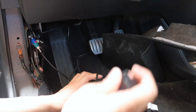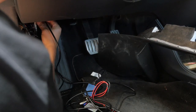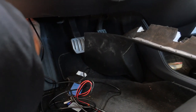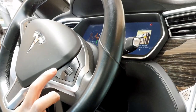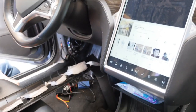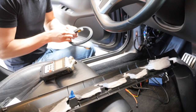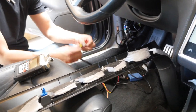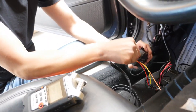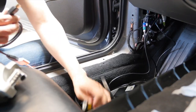Let's once again test to make sure everything is working. Connect the OBD2 connector back on. Next we're going to turn on the backup camera on the menu and then hold and press the menu button. You see that switching right there — that means it's waiting for a video signal to come in. So we are going to connect this Apple piece using the supplied HDMI cable.